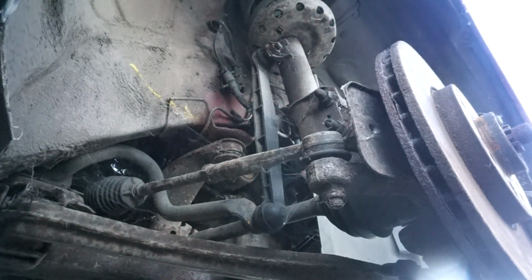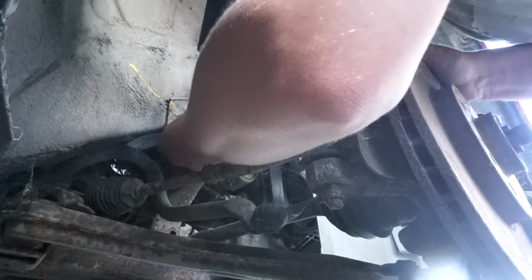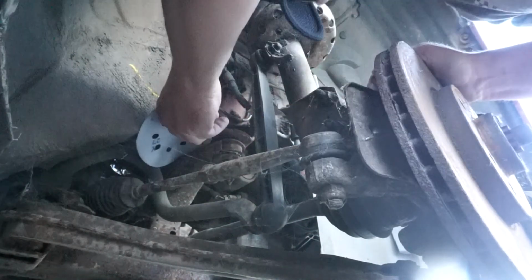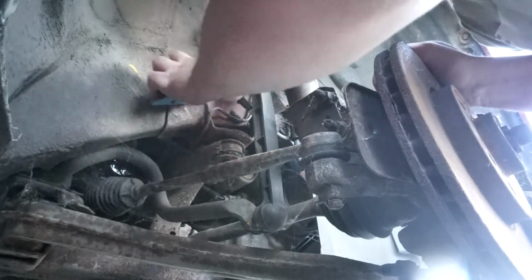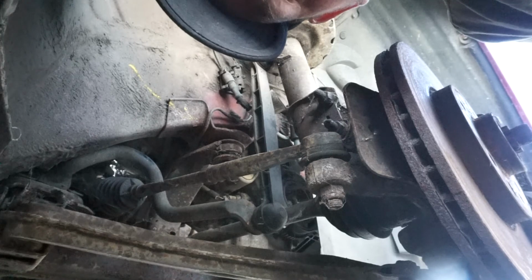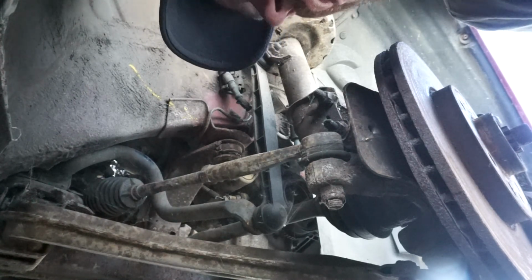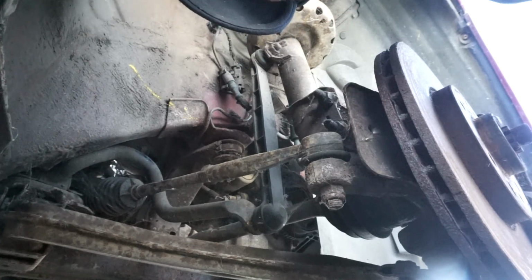I'm going to start sanding here with 120 grit. It's quite aggressive, but I think it's just right to get the coating off of these brake lines. So it's already looking better, but we're going to keep going so we get a perfectly smooth finish to check for damage, any pinholes, as that would be dangerous. And if it is dangerous, we just need to go ahead and replace it. So I'm going to keep sanding and checking.